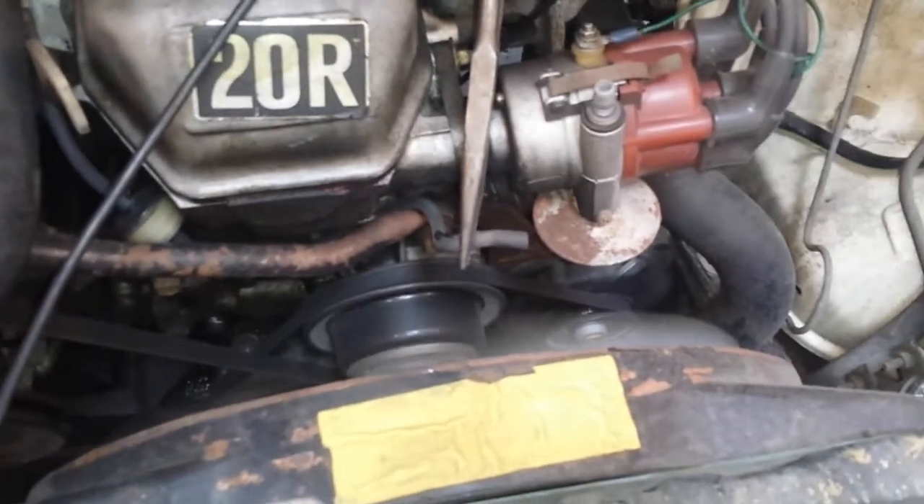So it's a fail on timing. The specification is going to be eight degrees, plus or minus three degrees, for California smog. So this vehicle is going to have to go get a repair done, which is going to be a timing adjustment.